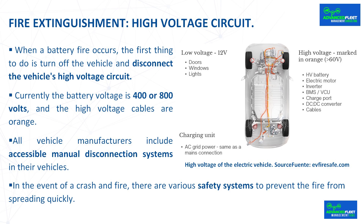In these cases the high voltage system is irremediably cut off. The case of the BMW i3 is similar: if any sensor detects a crash or any pyrotechnic element such as airbags or belt pretensioners activates, the circuit opens and stops releasing energy. And of course in a Tesla the same thing happens — if there is a crash and the airbags deploy, the circuit opens and the high voltage system is disconnected.